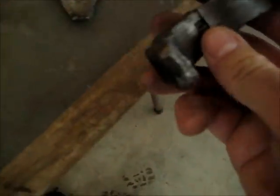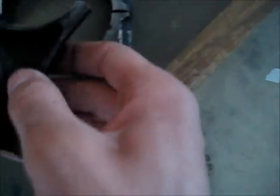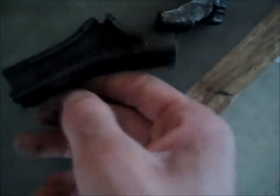You see, that's where it locks onto. The bearing snaps in here and holds on, but when it spins it lets go of them and just spins around. You can see bits of score marks here. Yeah, scored it. It did more damage to the crank than it did to this. Yeah, there's a big hot spot there though. That got very, very, very hot. Number 4, that must have been the piston or the cylinder number. I think that's on which way it went. It's just so badly damaged. That part there kind of gives it away, so what about there?